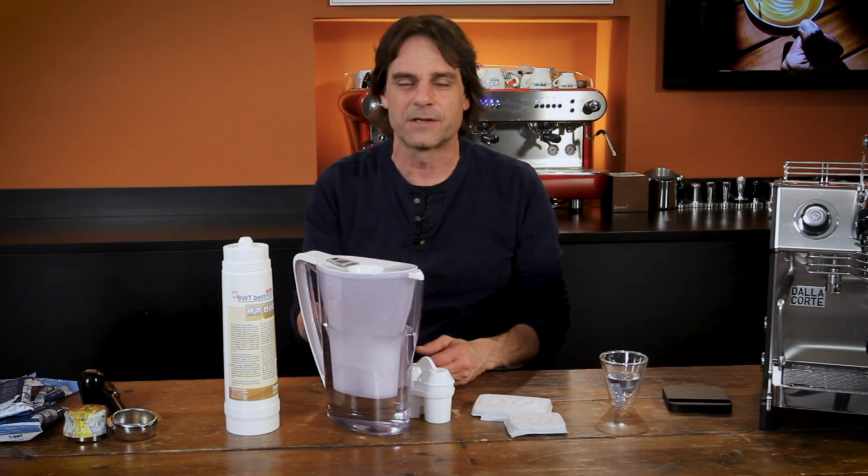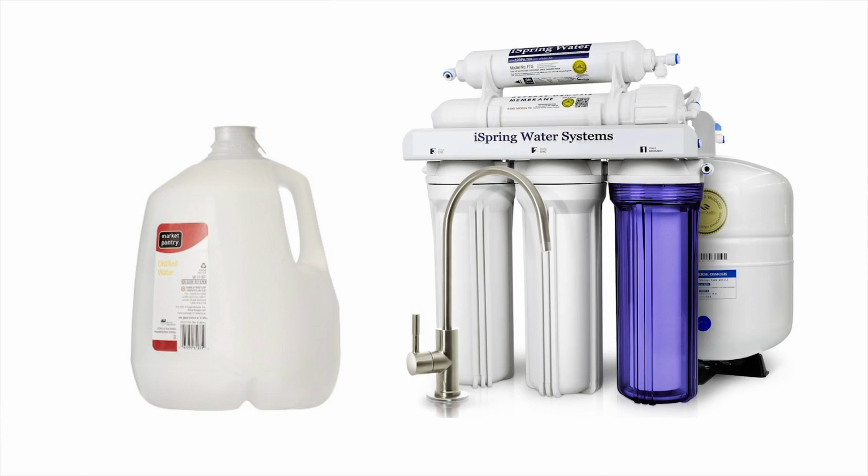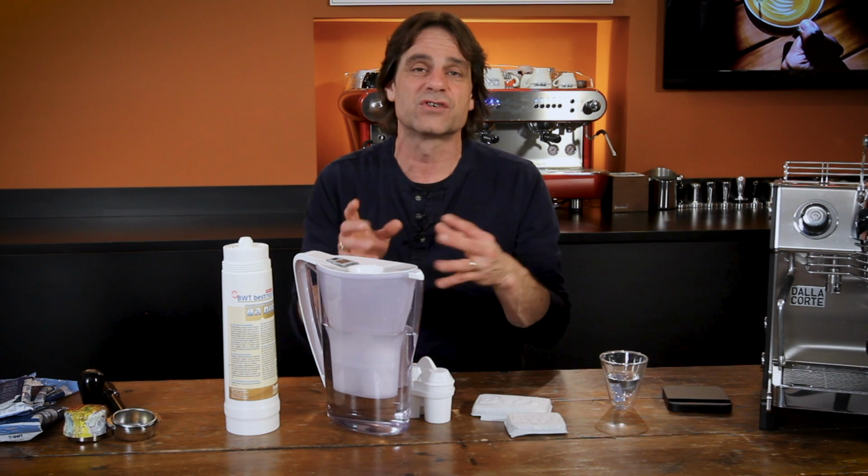And I just want to mention one other thing here with water. Well, two other things, really. A lot of times people say, well, I'm just going to use distilled or pure reverse osmosis water in my machine, and you don't want to do that. There's no minerals in that. So number one, the taste is going to be really off. Number two, you can get the opposite of scale, which is corrosion of metal components.